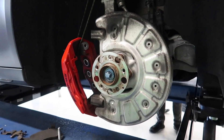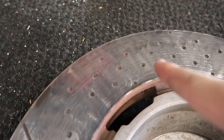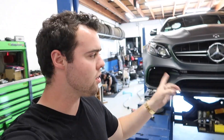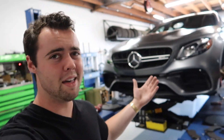Here's a look inside the brake components of the E63 — the caliper hanging down on a bungee cord. The rotor is insanely large. Originally these rotors were drilled and slotted, but there's so much buildup from the old brake pads that every single hole is plugged. We're also trying to figure out why the passenger-side brake pad has worn more than the driver side on both the E63 and the Huracán — and the rotor with more wear also had the plugged holes only on that side.